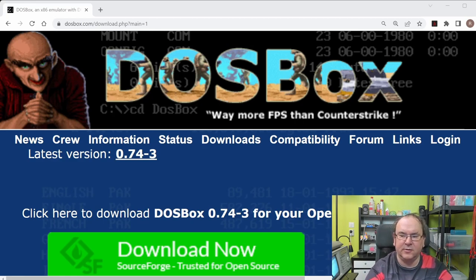DOSBox is not a direct tool to handle LIF files or disk images, but it could work as a basis for running tools, and I'll be covering all of those. It can run on Linux or Windows — DOS emulation. It is dependent on the underlying hardware, so if you don't have a floppy disk controller and a floppy disk drive, you're out of luck. USB floppy disk drives will still not work, but I included it because it's the way to emulate DOS.